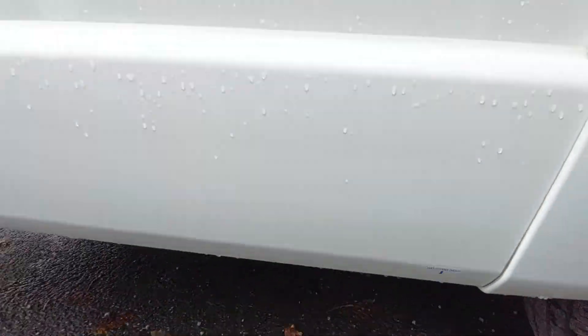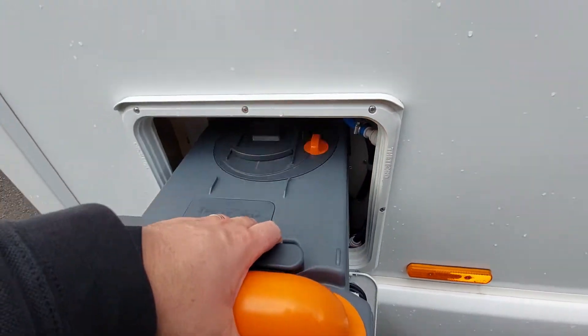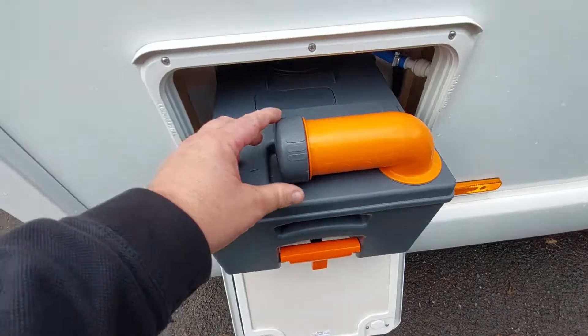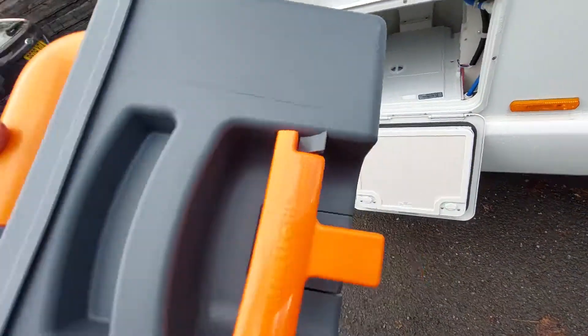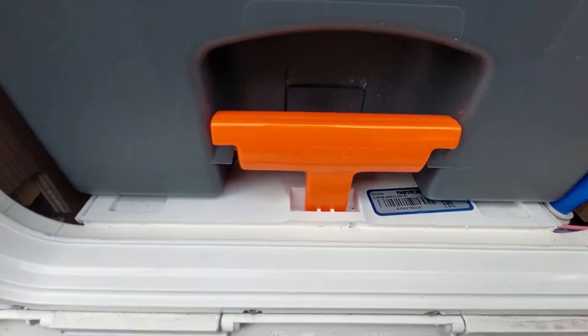When you're lining it up, the waste water just comes out of the little grey pipe just there — everything clearly marked. Behind that we've got the toilet cassette. To remove it, lift up the handle — make sure the valve inside is in the right position. There's a circle there for ventilation to flow freely and you unscrew the cap to empty it. There are a handle and wheels for this unit. When finished, just slide it back in and make sure it clips over the little lug.